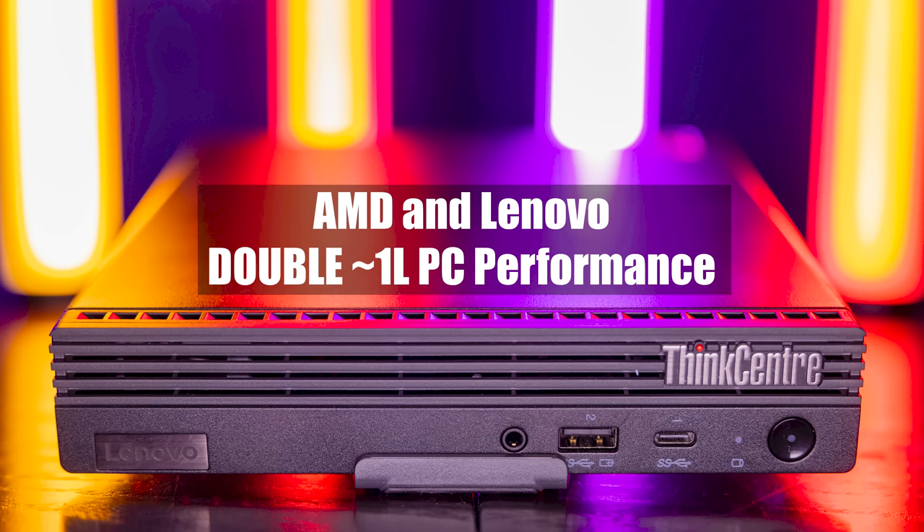DDR4-2666 frankly just feels kind of old. This has integrated graphics, so memory bandwidth does matter. If you look at the AMD-based Lenovo M75Q Gen 2, that was using DDR4-3200. This is Intel product segmentation that's a total bummer, but it does mean you can get less expensive DIMMs. On the Dell configurator, you can get two 32GB DDR4 SODIMMs for a total of 64 gigabytes of memory. For this processor that's a lot, but there are people who will want the Core i5-10500T with 64 gigs, and it's not a crazy combination.